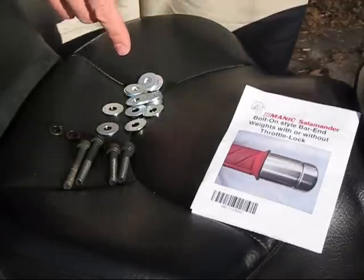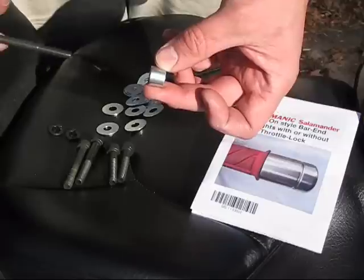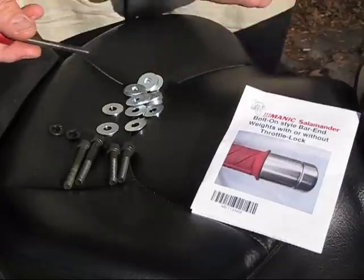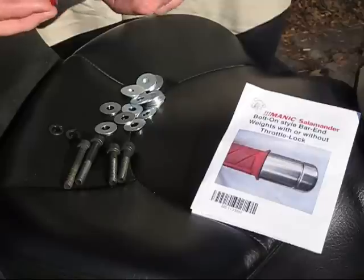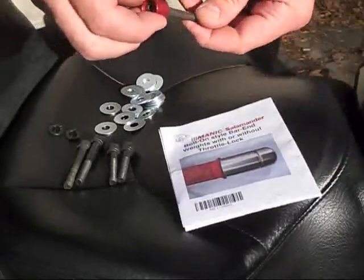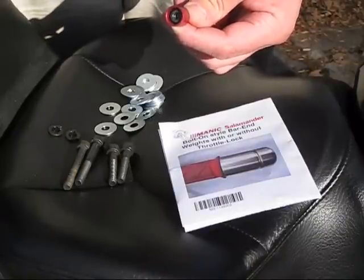One thing that, because of the bike I'm going to demo on, you're not going to see is what I call a nose. A nose is just something that the screw can go through and the weight will go on over. That nose interfaces with the end of the handlebar. It just so happens that this particular bike doesn't need a nose, so the thing that meets the handlebar is one of the shims — no big deal. Another thing you won't see in this particular kit, but which is on some bolt-on kits, is this red thing which goes in the end of the weight. It makes a sort of a red ring around the bolt, which you might have seen in one of the pictures on the website. The ones with bigger bolts don't have those, and this is one of those.